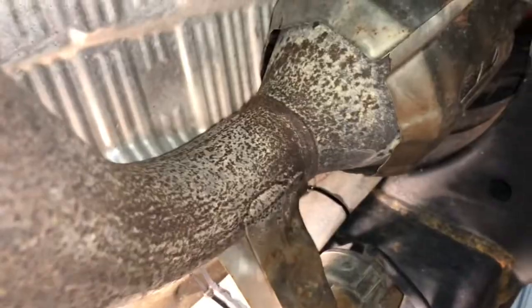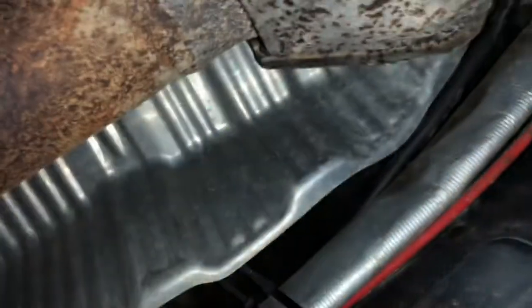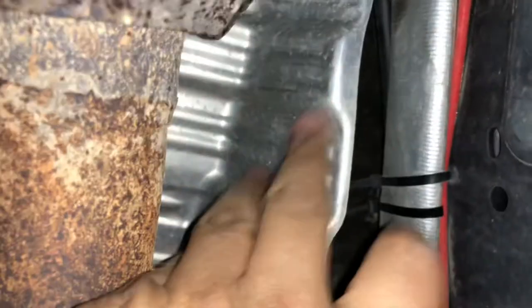Then once we get over here, you're behind the pipes for the exhaust and the catalytic converter. So I started running it behind this heat shield to kind of protect the wiring. You may want to do the same. So here it is again. Cross frame. Here it is a couple more. And then over here, you can see that it's tucked above the heat shield for this one, right above this heat shield.